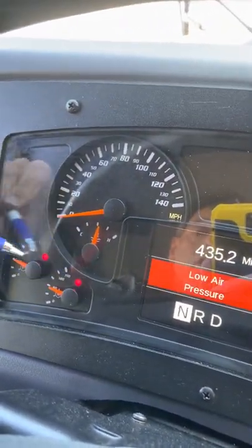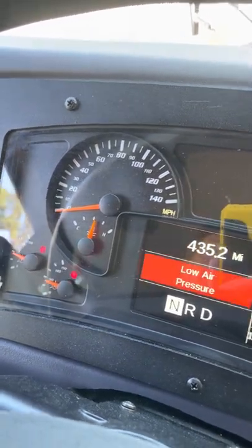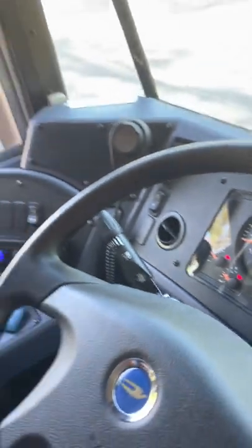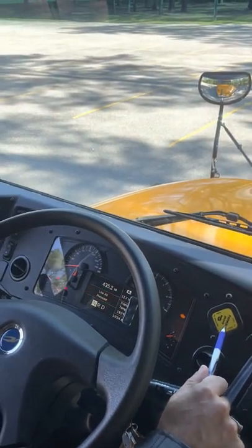Make sure that the two lights are on. Now I will keep fanning off the service brake with my foot. And when the air pressure reaches approximately 40 psi, the yellow knob of my parking brake will pop out like a spring. At that point the parking brake will be engaged.